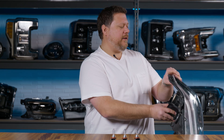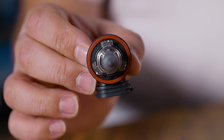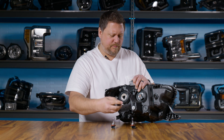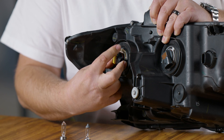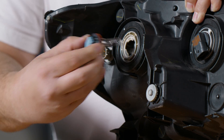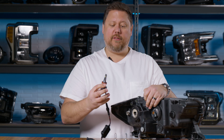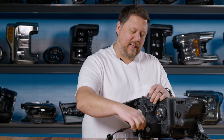The first thing preventing you from using a high-power bulb in a lower-power position is how the bulb mounts to the housing. If you look at the back of this Tacoma headlight that uses an H11 low beam, you'll see three openings where the bulb goes in — those openings line up with the three metal tabs around the perimeter of the bulb collar. The H11 fits perfectly, but the H8's tabs are offset slightly so one tab doesn't seat. The H9 has the same issue — different tabs won't align. That's because the tabs are either different sizes or in slightly different positions around the perimeter. A universal H11-style LED bulb works just fine because its three tabs are small enough to line up with any of the original halogen bulb orientations.